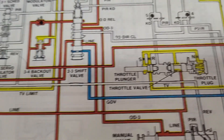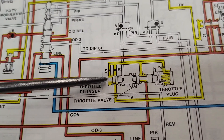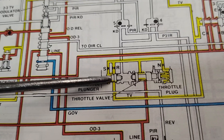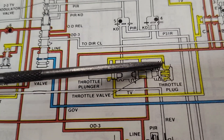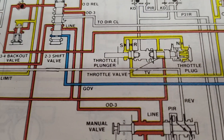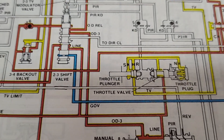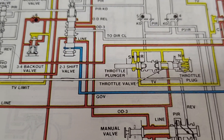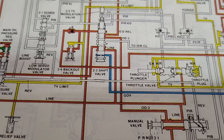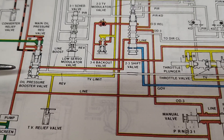This is basically just another pressure regulator within the circuit — let's call it a subroutine. It's taking the main line pressure and regulating it down to work other circuits. What these other circuits are: it's working in opposition to the shift valves. So the higher the TV pressure is, the later the shifts are going to occur. High TV pressure equals high shift points. Low TV pressure equals low shift points. And also, low TV pressure means low main pressure; high TV pressure means high main pressure. Those are the two things that it's doing.